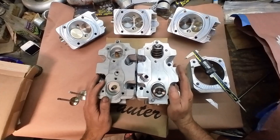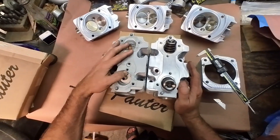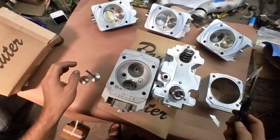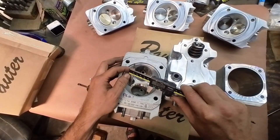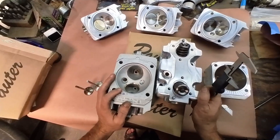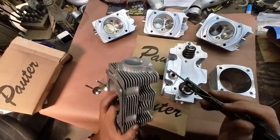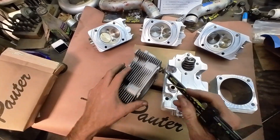The cost of the cylinder heads seems outrageous at first. But if you take a stock cylinder head and change the valves — put in brand new oversized valves — you'll potentially have to change the seats too. We've got a 52.5mm valve there, so the seats aren't even large enough. Same thing on the exhaust side: 44mm seats — we could potentially get a 44.5mm. Be very close to getting these valve sizes in a stock cylinder head with Euro RS stuff. But if you put in new valves, change the guides, add high-rate valve springs, titanium retainers, machine up the SAI ports, do port work, fly cut, surface, and flame ring — these heads also require welding to gain strength.